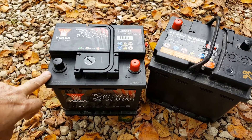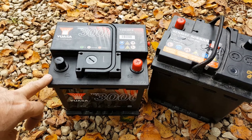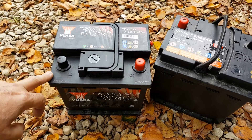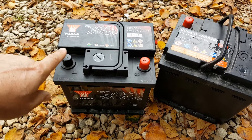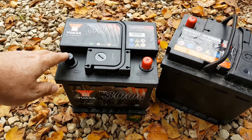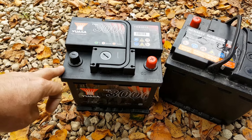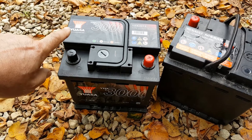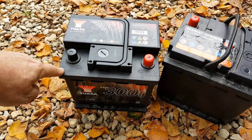It's always worth charging your new 12 volt battery before fitting it in the car. New batteries aren't fully charged — they're kept at a lesser amount because it helps when storing them for long periods, as they sit on shelves for many months before being sold. Plug it into an external 12 volt charger for 24 hours before fitting, or at least the night before, to bring it to 100 percent. The Zoe's charger also has a habit of not bringing these to 100 percent while in the vehicle, so it's great to charge it first. It should then last typically around two to four years.